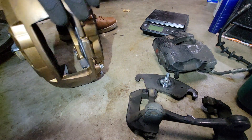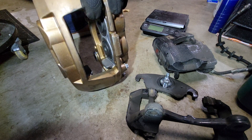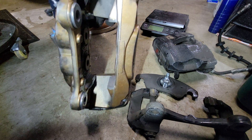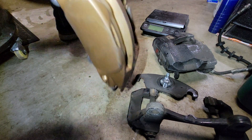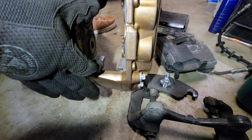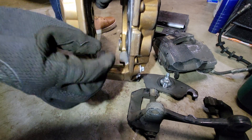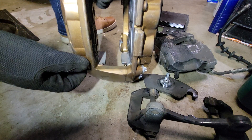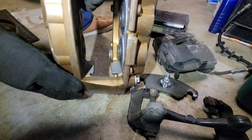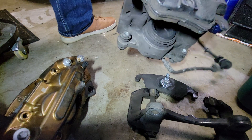If you're going to go out and do track work, the very first thing you should look at upgrading on your car is the brakes. And the wonderful thing about fixed calipers is they're super easy to change pads on — you can have a street pad for the street, bring your track pads with you, swap them at the track using the retaining pins, run your track day, then put your street pads back in and drive home. You don't have to unbolt the caliper like you do with sliders.